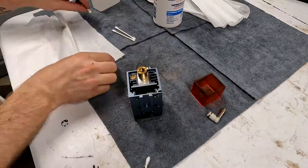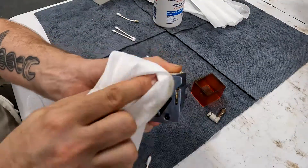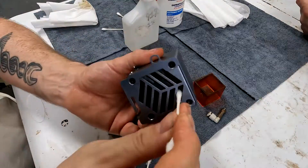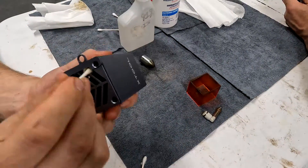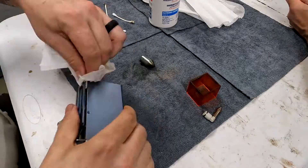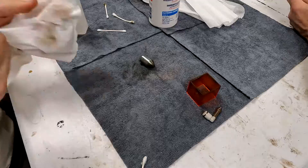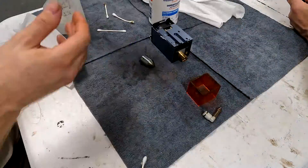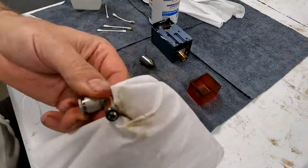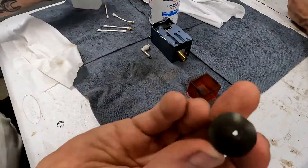That's where your cooling is for your laser, so that'll help keep the laser cooler and keep it working better. Pretty much the same thing around the cooling fan — spray the q-tip, not the laser itself, and get in there and clean as much as you can away from the fan. That way the fan spins freely. If there's buildup on the fan, that'll slow the fan down and again it won't cool off as easily. The more you do this, the longer life you're going to have out of your laser.